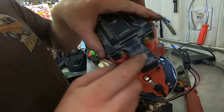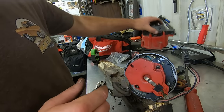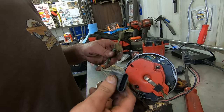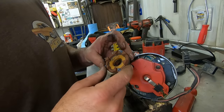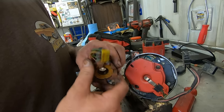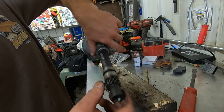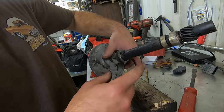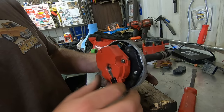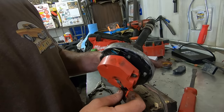We just got the one wire going off the bat that runs everything. 12-volt power from the key source. And we eliminated all of this just by going with a little bit older reluctor wheel, coil pickup, whatever you call it. So I'm gonna clean the garbage out of these cam gear teeth. Maybe clean the rest up. Nah. We're gonna go drop it in, point in the same direction, throw our cap on, hook our wires back up. Hopefully she works.